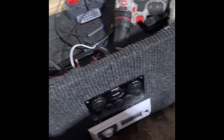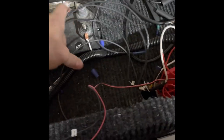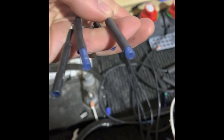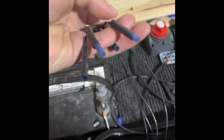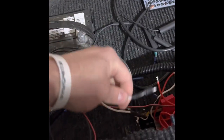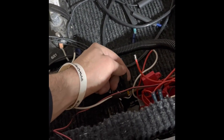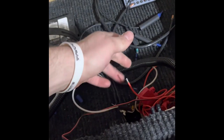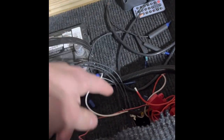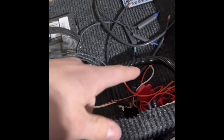We got the stereo put back into the enclosure. All the wires have been run with heat shrink on the connecting side to the radio itself, and the connections to the speakers are ready to go. The connector butts are on there, the heat shrink is on there, and we're going to get started to wire it up. After that, we'll be doing our ground and finishing our power side — I put a connector butt here — and then all that's left is to take your power to your connector. That is your accessory and constant power, and we will go into greater detail in a moment.